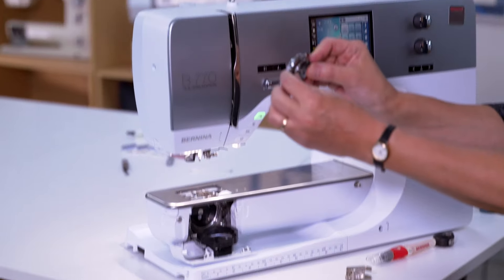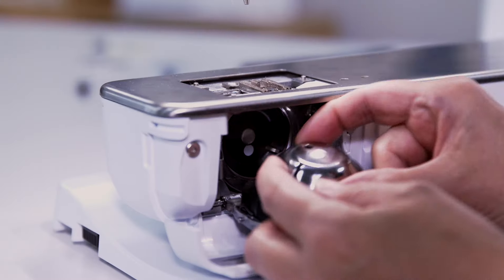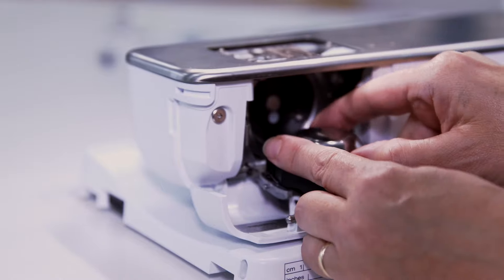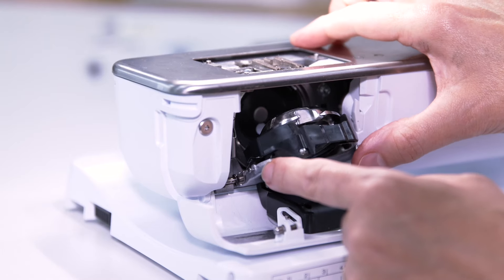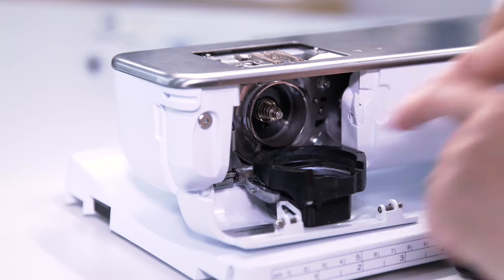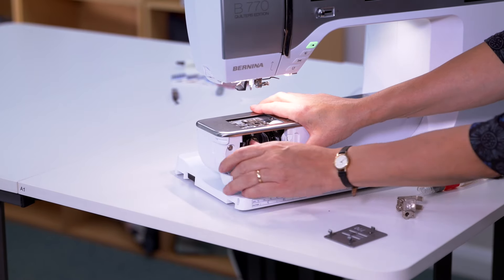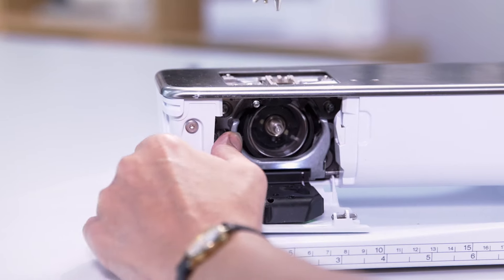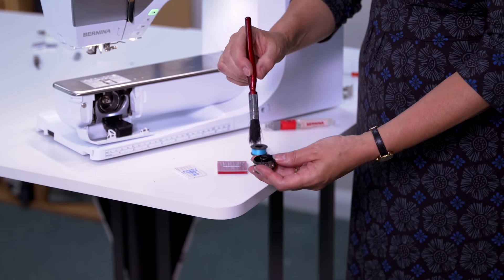Now I have to replace this big circle back in, and I know that a lot of you tell me you have problems, but there is a clever little trick which does help. I just take it forward, place it in there like that, and then give it a little wiggle and it drops into place for us. Once it's in there and firmly done we're going to click it back into place, checking that it doesn't come out. We then need to just make sure that our bobbin case is clean and the brake spring is in place correctly — just give it a little wipe round.